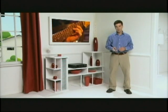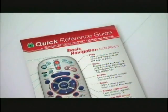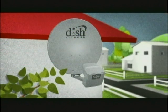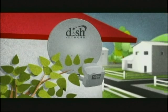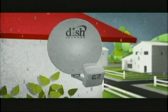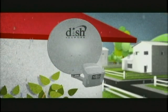To help you remember which channel to tune to, your technician may have put a sticker on the back of your remote or written inside the quick reference guide. Don't forget to return to satellite mode by pressing SAT on your remote. On really rare occasions, you may lose your Dish Network signal. To troubleshoot this, first make sure there is nothing obstructing the dish antenna, such as a bush. You may also want to make sure there is nothing blocking the eyes facing the dish antenna that capture the signal. Normal weather patterns should not impact your signal. If you find repeated instances of losing your signal during normal rain showers, your system may need to be tweaked to maximize your signal strength.